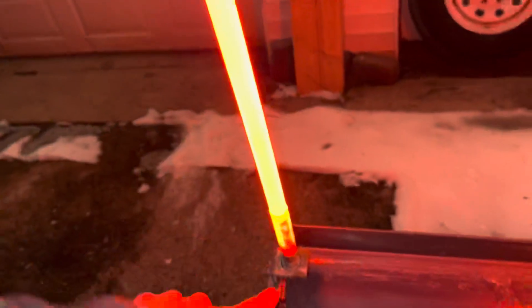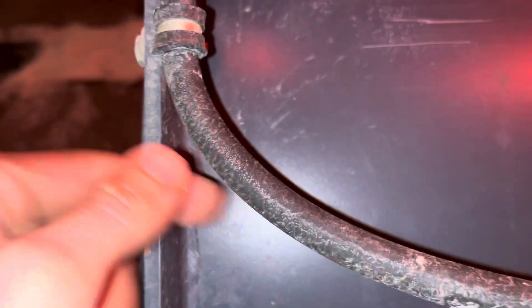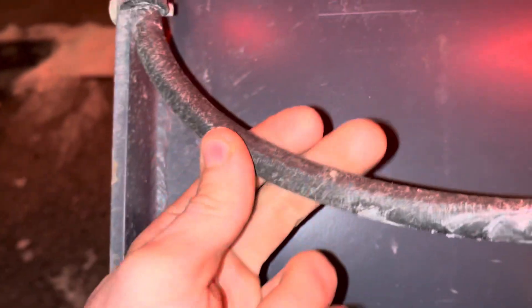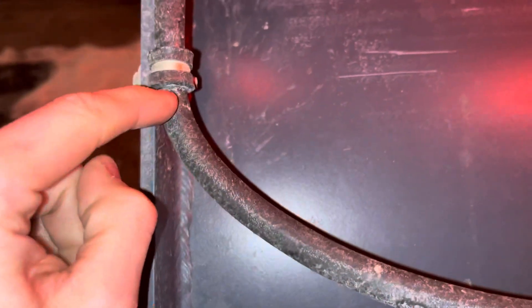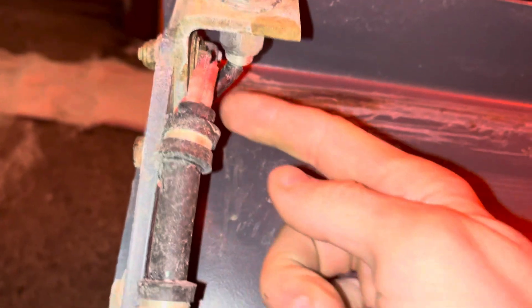One basic question I get all the time: the diodes are actually only facing this way, which means the part that faces the driver is darker. For the mounting hardware, I bought some stainless steel vibration dampening clamps from McMaster-Carr — these are half-inch inner diameter. I got some half-inch outer diameter fuel line, then I used genuine Loctite super glue to glue the vibration dampening clamp to the rubber hose.